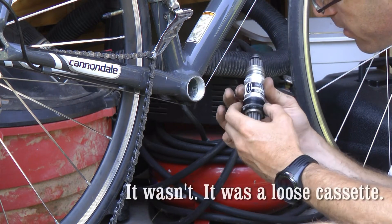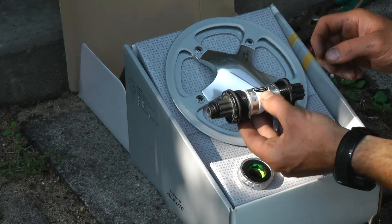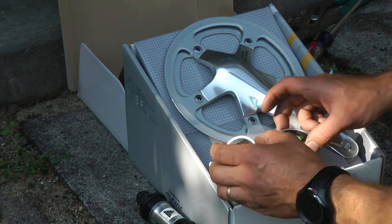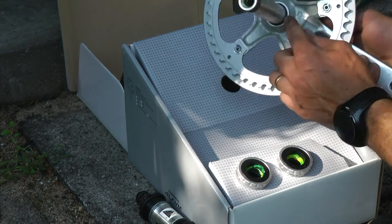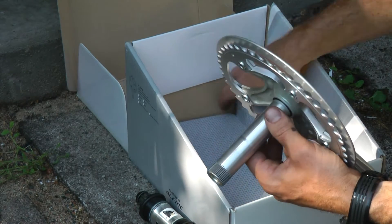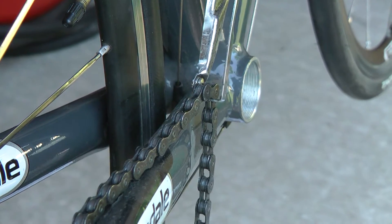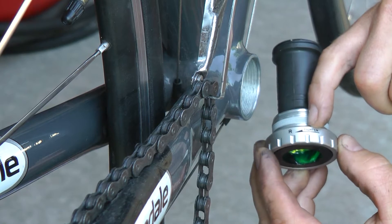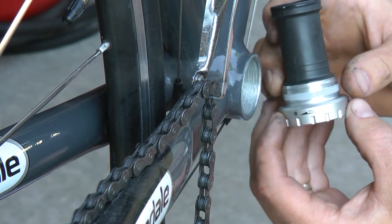There's a lot of metal in there. It's remarkable how much heavier this bottom bracket is than this one — it's like three times as heavy. I guess it doesn't include the axle, so that sort of makes sense, but the axle is actually fixed on the new one so you don't have to worry about the pedals getting loose. The other arm then clamps on here. The bottom bracket is well marked — right side — and it's got an arrow to show the reverse thread. It comes already greased and even has some thread lock on it.